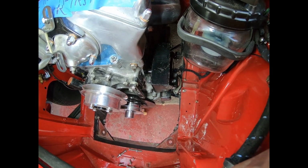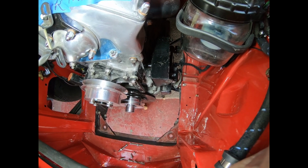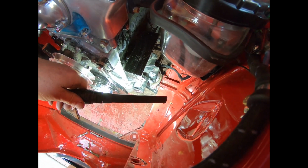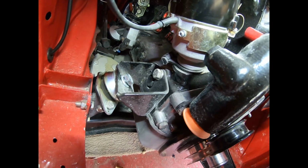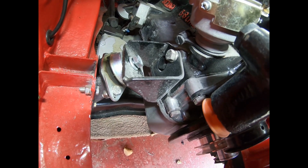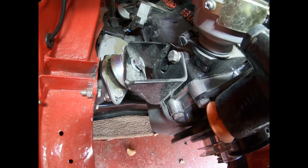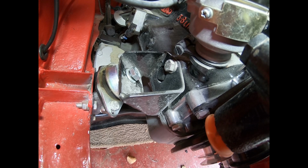I've got to modify this bracket to mount the alternator. So I thought, okay, I've mentioned it before. The generator bracket is kind of overkill just to support the engine. Well, Gary, you need to get one that's similar to the one here on the driver's side, right-hand side. So I jumped online, and I see these for sale for an XJ6. Remember, the block is basically the same. They didn't change the casting, they may have changed the bores and stuff like that.